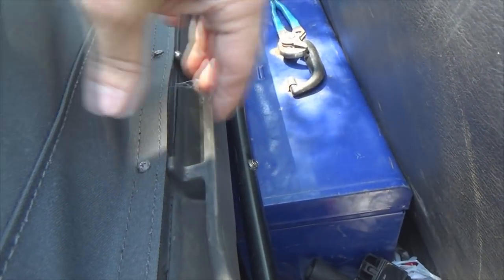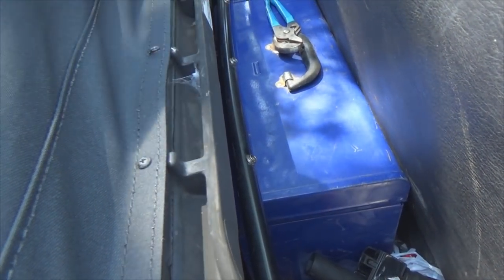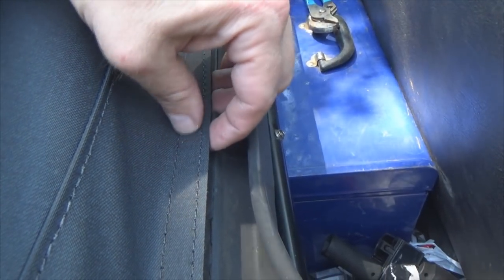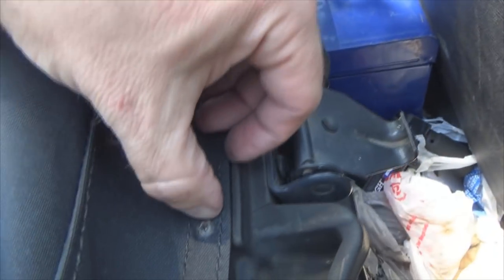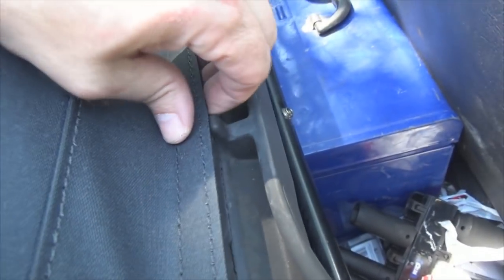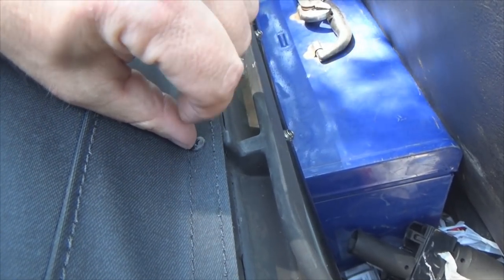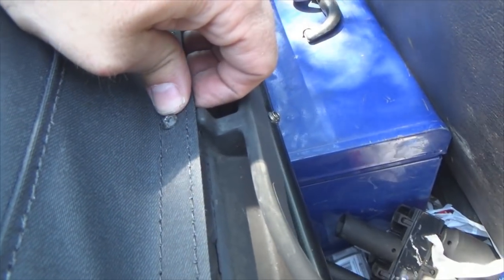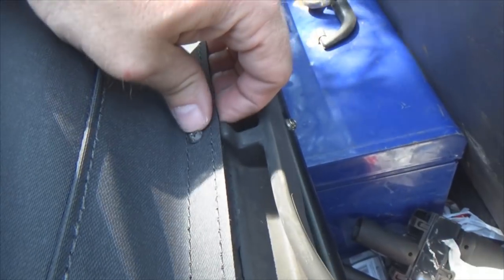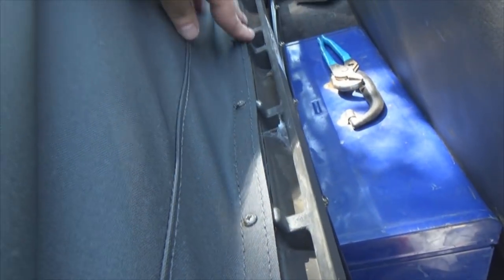As a general rule — and if you pay attention when you took the top off — each one of these ribs is where your screw hole location is going to be. Bestop did put some slots in place to get you centered, but a few of them didn't have pre-drilled holes. So you just kind of line up right here, pick your material up, see where your screw head is hidden, run it through the channel just a little bit, get the tip just protruding through, then line it up with the hole and drive your screw home.